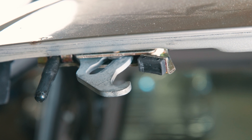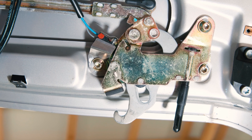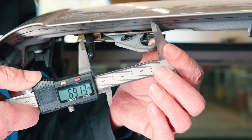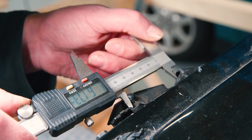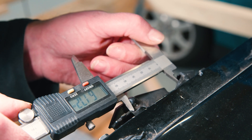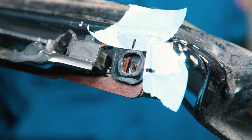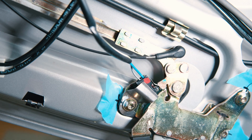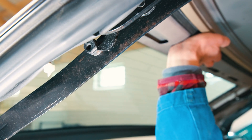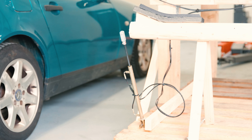This corresponds to the movement of the front pins and rotary latches when viewed from the front. In addition to the longitudinal movement of the hooks, their guide cam shape allows for the necessary lateral movement, ensuring a proper fit into the lock catches of the windshield frame. The plastic-coated pin aids in the initial contact and insertion of the roof into the windshield frame. On the right side, it also activates a micro switch. The lock catches can be adjusted laterally, and adjustability through elongated holes or shims is also present in most other joints and locks as well as in the cable housings.